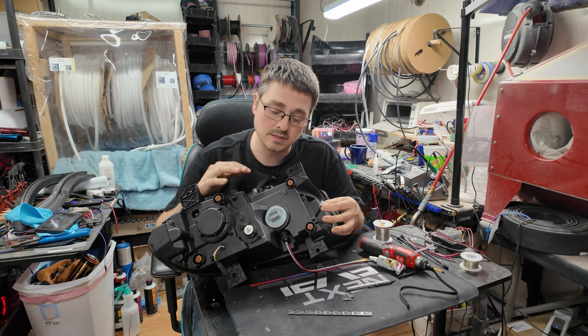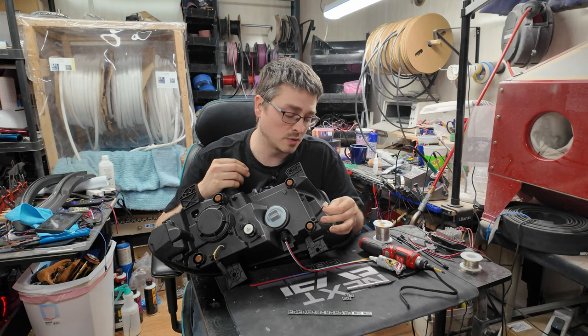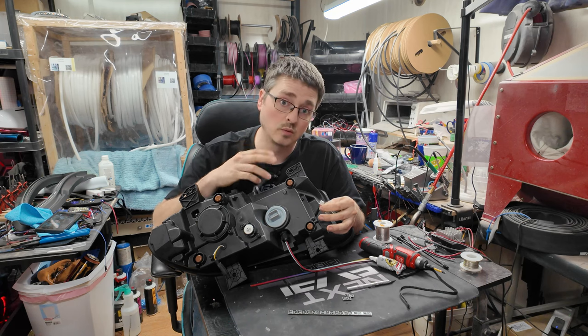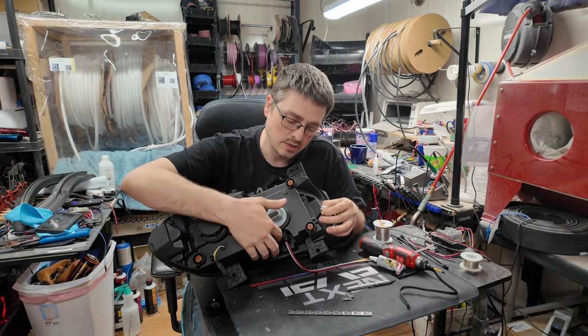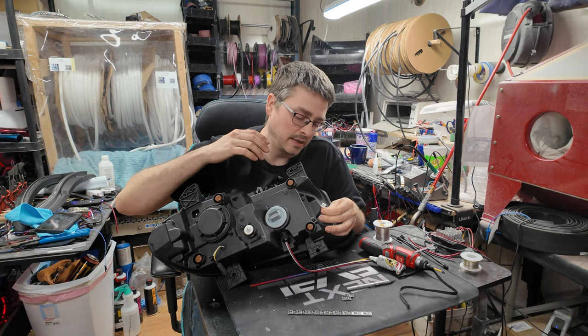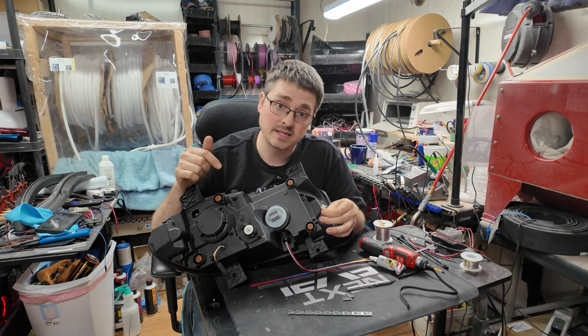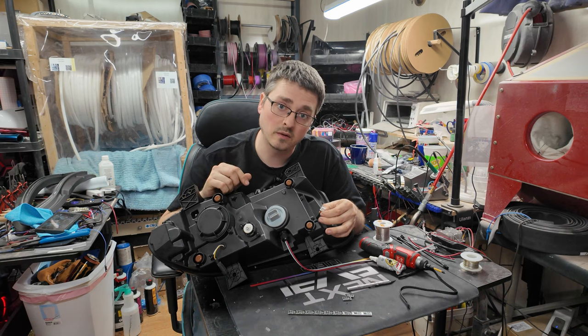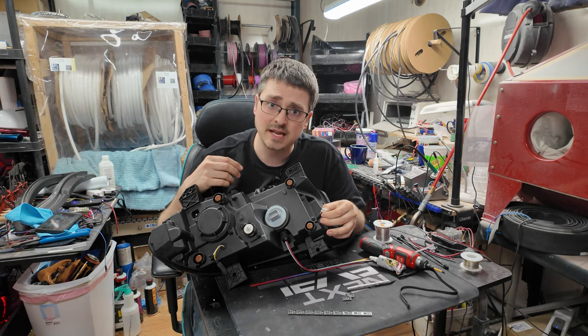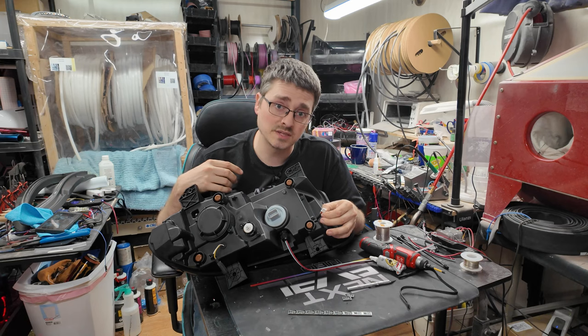For this light, this is the driver's side light for the charger. So all I will be doing is tapping the yellow wire and running that out the cable gland as well, so we can get that connection. And on the other light, I already tapped the DRL and the turn signal and ran them out as well. And for that one, once again, I did use an 8-pin connector. For this one, I'm going to use a 6-pin.